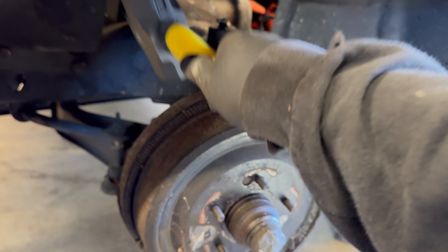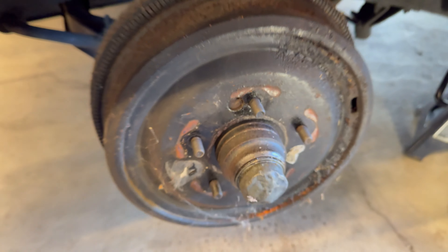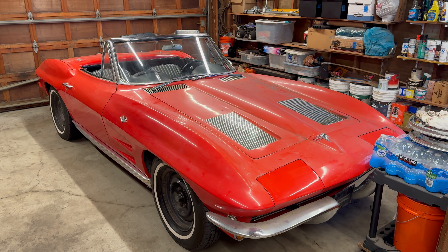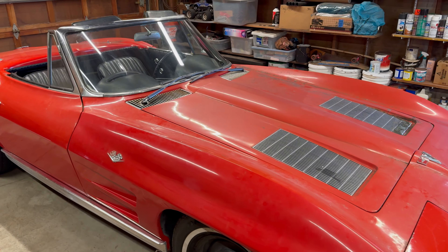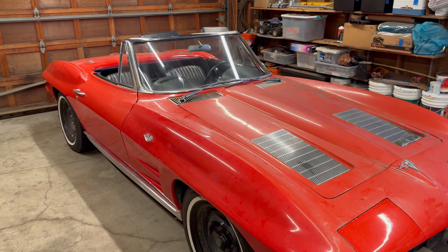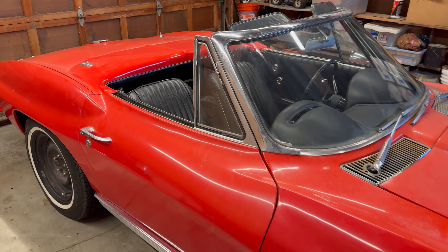Did the last one. We can finally see it working. Just drove this thing around the block for the first time. Looks a little different with the hubcaps off. All we had to do was change the spark plugs, drain the old gas, put in five gallons of 91.